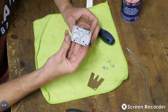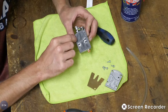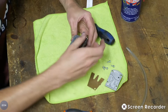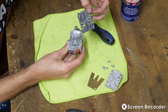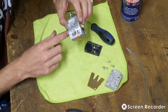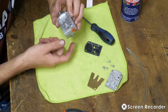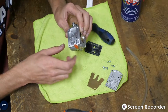This plate is off — there's nothing on this plate, just an empty plate. And then this is your gasket that goes on here; this is exactly how it should look. This is actually a separate diaphragm and sometimes these come in separate pieces, sometimes this is all one diaphragm. To get this off, just be very careful. Get underneath and pull up nice and slow. Your diaphragm is now off, and this diaphragm is a one piece. Now inside of your carburetor, inside this little hole here, there's actually a little metal screen. You don't need to take this out — once you remove the other side, you can back pressure it and it'll shoot the crap out that's in here. You just hold your finger over it.